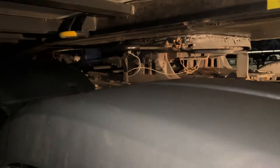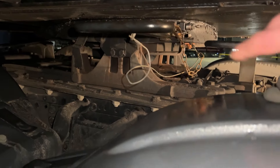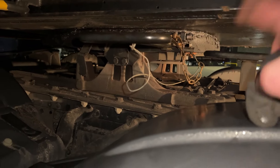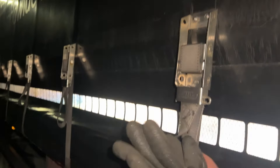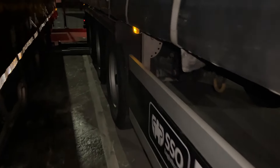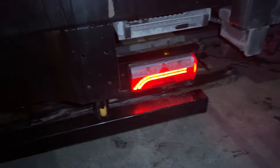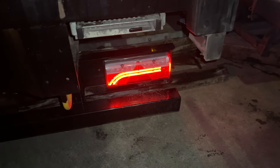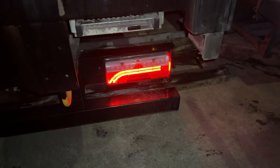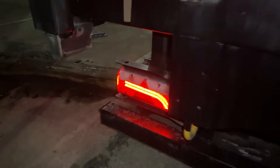It's a nice and very fresh morning today. I've hooked up to the trailer — always make sure the clip is secured and always double check it. For the trailer check, some of the things I'm looking for are no damage on the curtains, all the straps are in good condition, the side guards are in really good condition, and the tyre tread as well, making sure they're all nice and secure. After you're hooked up to the trailer, go around and do a second check with the lights switched on in the cab, just to make sure all your LEDs and lights — everything is working.